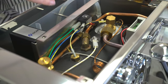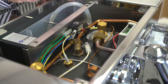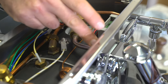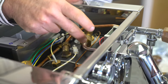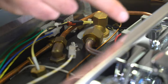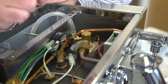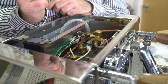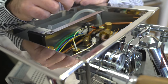The water pipe goes towards the bottom — steam pressure on the top of the boiler pushes the water down, it comes up through this pipe and goes out the hot water valve. Something I look at on heat exchange machines is the width and quality of the thermosiphon loop to and from the group head; there's another pipe down in here. Some manufacturers are really skimping and putting a very thin tube. We want good water flow to and from. Sometimes you'll find a bigger one on one end and a smaller one on the other to manage overheating of an E61 group head — which is why people have to flush. Here is your bleeder valve, and here is your PID sensor.